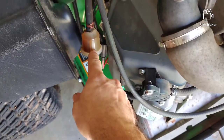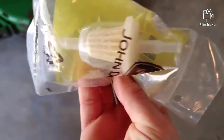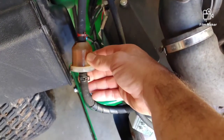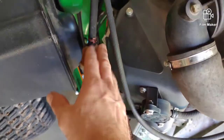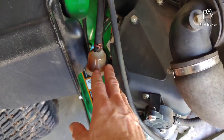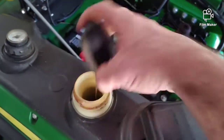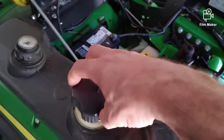If they haven't changed that fuel filter often, this one needs to be changed. I like to put a clear one on so you can see the trash build up. This is very easy to change — all you need is a pair of pliers. This filter is about five to seven dollars and will save you a lot of problems. For the o-ring, you can order a new gas cap or find an o-ring that fits — it'll solve you a lot of problems.